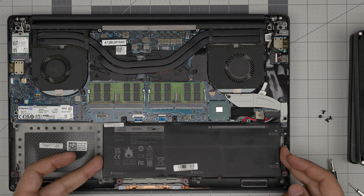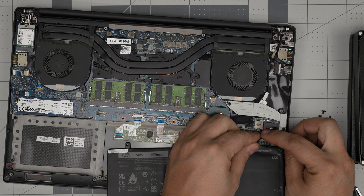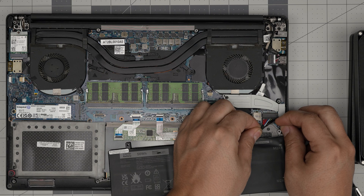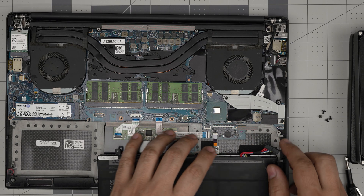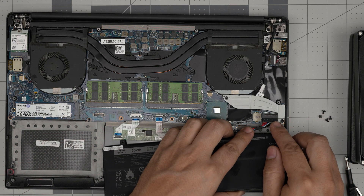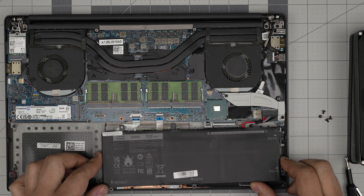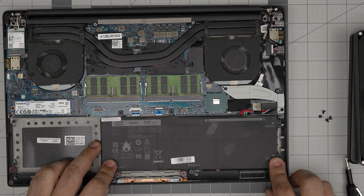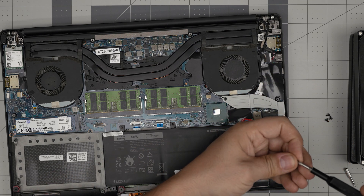For those who want to disconnect the battery: remove the three screws, lift the battery up and bring it to the offset position. You now have space to work. Pull the cable back, using your finger to help the black side pull back gently and evenly — don't yank it sideways or you'll bend the pins. To reconnect, bring it evenly into the jack, pinch it in, make sure the screw holes and pin holes on both sides match, and it falls into place.